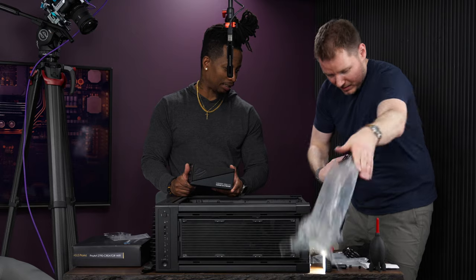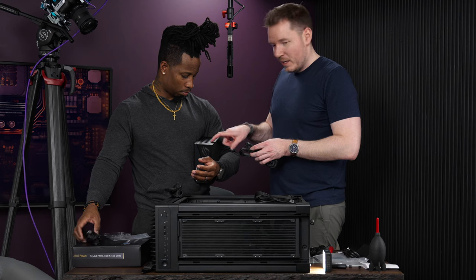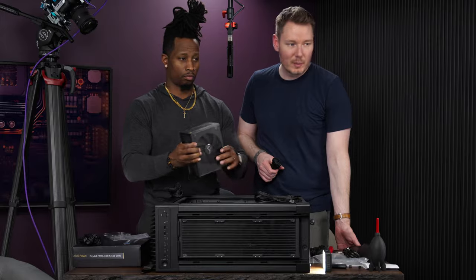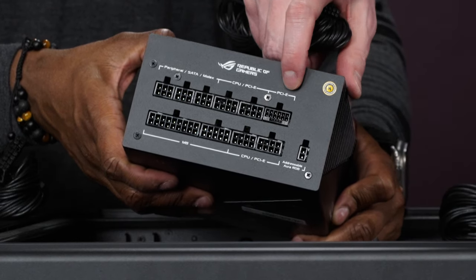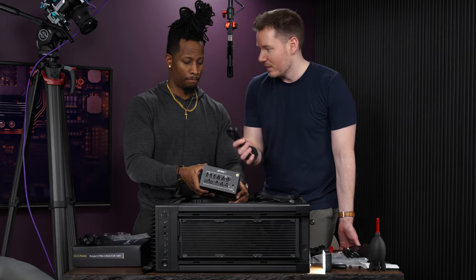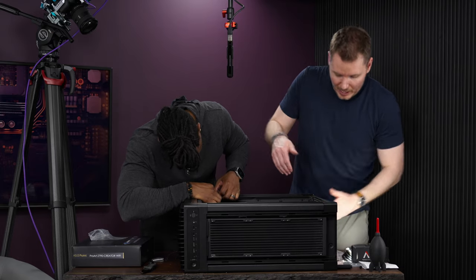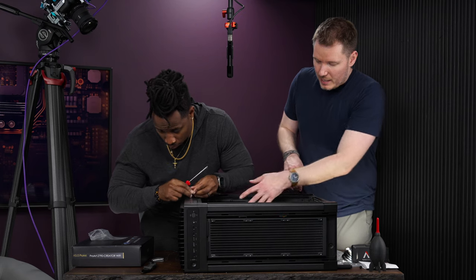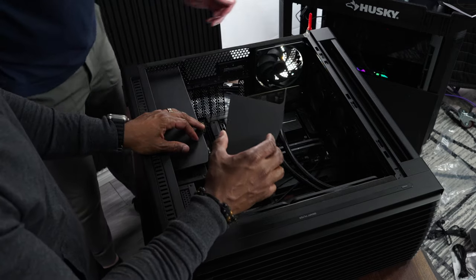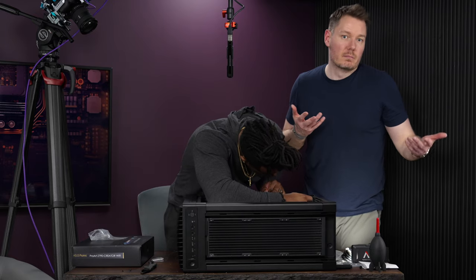There's a whole gang of power supply cables. This must be a pretty modern power supply — it has the new 12-pin connector with extra four pins on the bottom for modern GPUs, going right into the power supply, so far fewer cables to run. The case uses a large two-piece shroud instead of a conventional bracket system, with what looks like a hard drive cage underneath. You remove the shroud, screw the power supply in directly, and put the shroud back on.